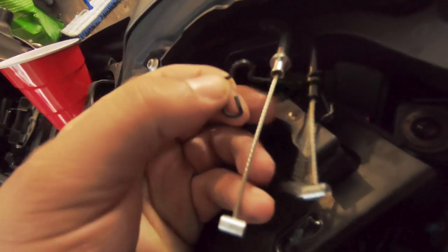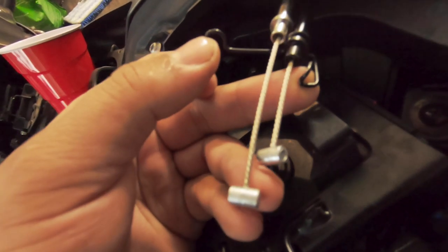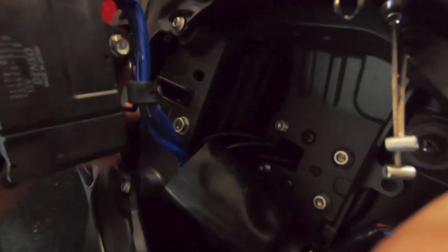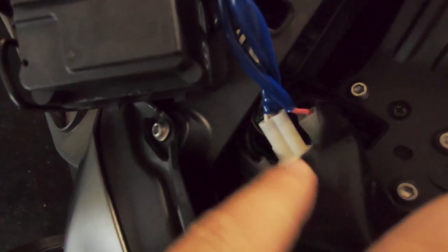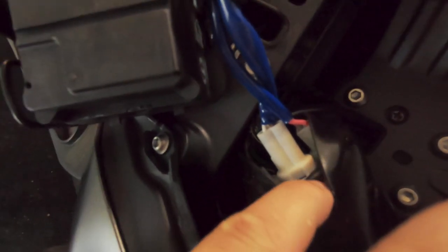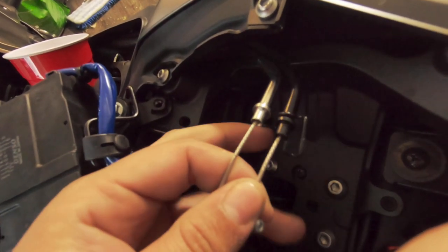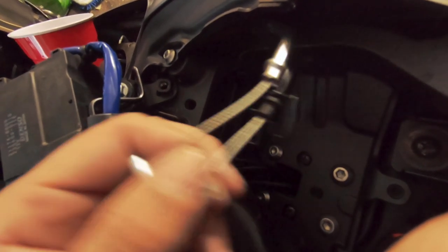When removing the cables, I saw that there was a clip that links in. I just took a pliers and pried one side off, and as soon as I did, both sides came out since they're linked together. Servo motor's now almost fully loose. If you look in here, you get your plugs in there, so just follow the servo and unplug it — that's where your servo buddy is actually going to plug into, so it shouldn't be too difficult. You'll see what I mean when you look at it. You just pry one end off and pull them out of the servo housing and it should be good.